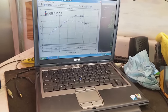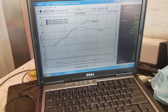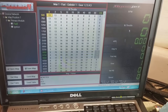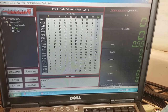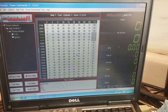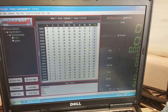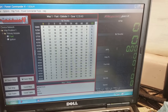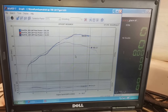If this is something that interests you, give us a shout. These are real, fairly easy installs requiring general mechanical skills. I'll show you this fuel map while we're here — I know a lot of guys are always interested in what the fuel map looks like. In the top end we're seeing high 20s in fuel, kind of high teens through low 20s through most of the mid range, and down at idle we're in the 13s — which is what this particular motor likes. Nothing too extravagant. These 2015 and up bikes have entirely different fuel maps than the 06 through 12s because of the ECU. That's why we got huge gains for not a lot of money.